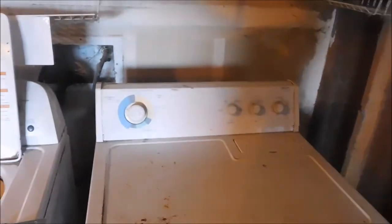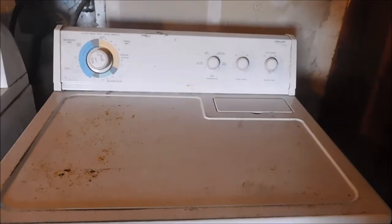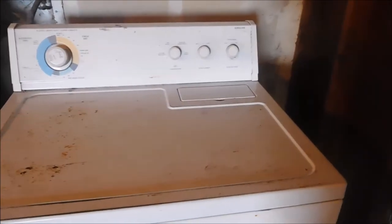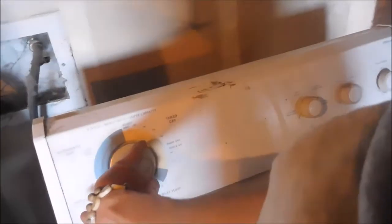How's it going? Spill the Handyman up here in Northern California. We're looking at a Kirkland dryer - basically it's a Whirlpool machine sold by Costco. What this does is it will run for a little while then quit, so that indicates to me it's got a weak motor. We're going to lube the bushings and bring a little life back into it.